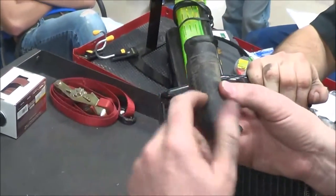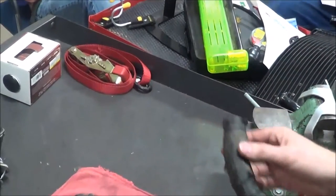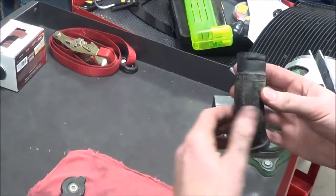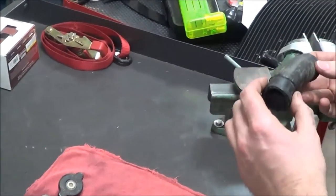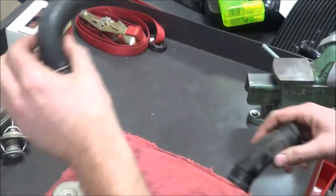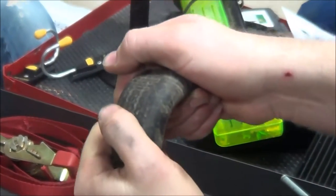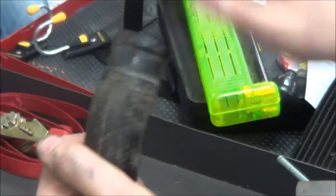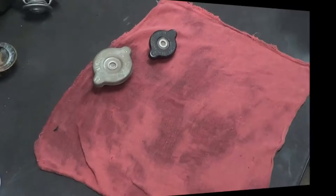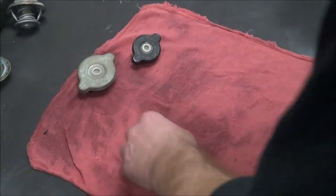If you do that, you're probably not going to damage the hose. You might say a radiator hose has got to be cheap at O'Reilly's or AutoZone, but formed hoses are expensive — especially motorcycle ones. That's where people say 'I'm not going to pay 40 bucks' and put a non-formed hose on. But when you try to bend a non-formed hose that's short, it flattens out, gets hot, kinks, restricts flow, and usually blows off or leaks. So there's no choice. The popular option in the motocross and sport bike world right now is colored hose kits, which are pretty inexpensive compared to OEM.